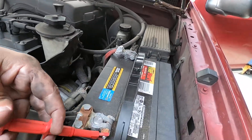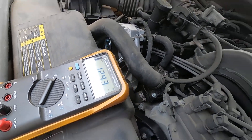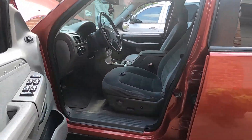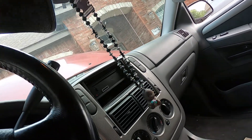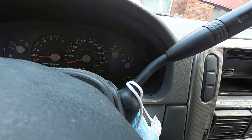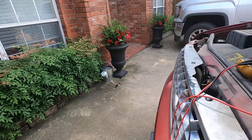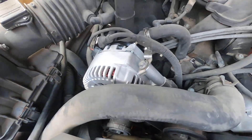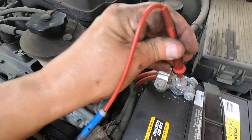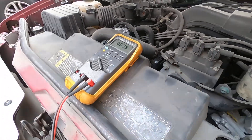We got the battery top charged — 12.4. That should be plenty good. Let's go ahead and start it up. Let's make sure the battery light does go out, which it does. I can already tell that the voltmeter is a little higher than where it was. I can actually hear an alternator whine, so I can already tell the alternator is charging. To verify that, let's go ahead and hit our positive. We've got about 13.8 at idle. If we revved it up, I'm sure it would go higher.